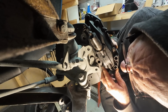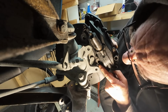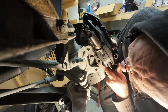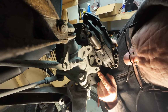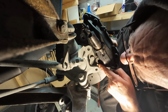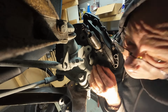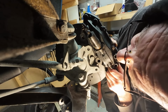So I've got to machine this block of steel, then cut it away so that it touches there. So it'll be there, bolted through the block all the way, and the steel will come up the back here, but be milled away so that I've got a tag there for the M12 bolt. Likewise, when I get up there, I don't know if I'm blocking the camera here with my head, but when I get up there, I've got the same thing.